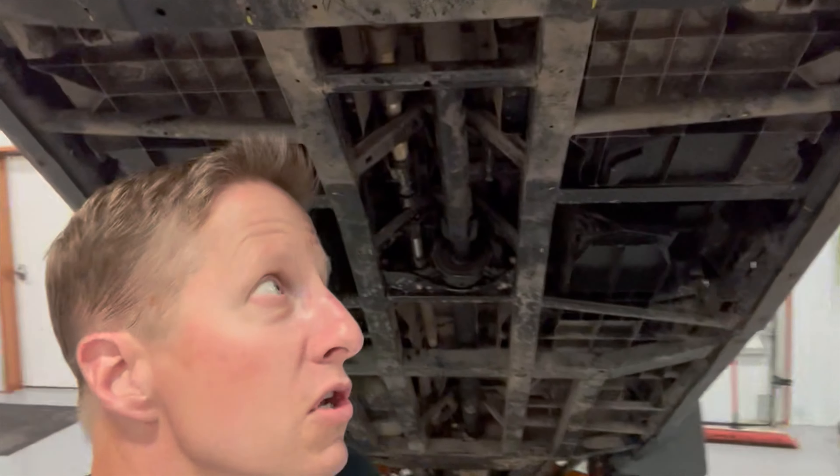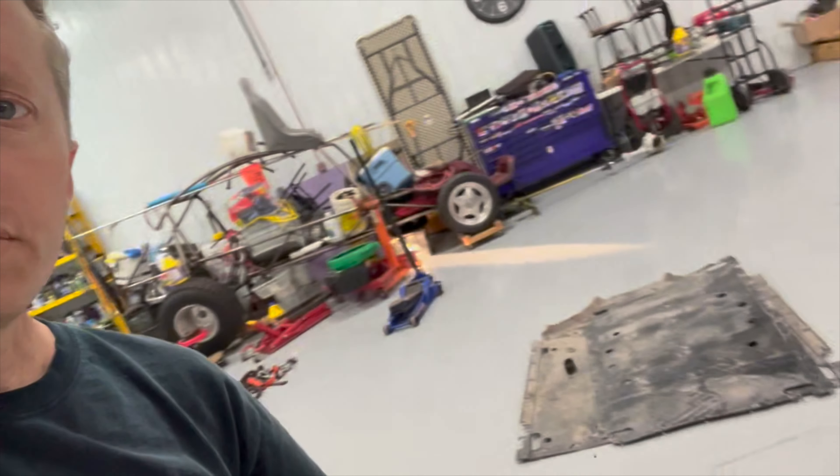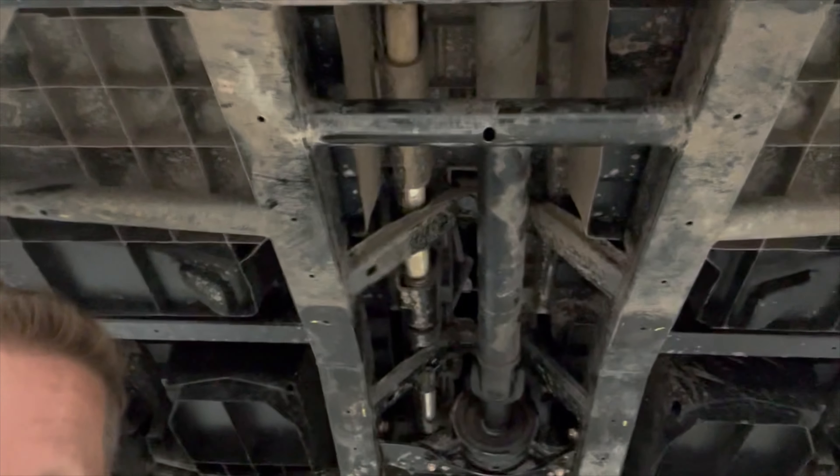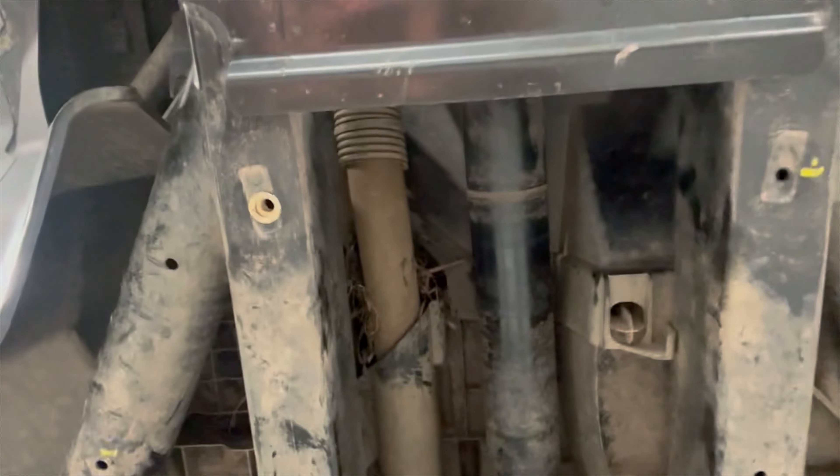I want to go through what you actually have to do to pull all of these off. There are a ton of rivets under here. Skid plates are off and over here. Use a 7/32" drill bit — kind of rotate the drill in the head inside there and they pop right off, came off super easy. All the skid plates are completely removed all the way to the back. We did a quick dry run of one of the nutserts right there — it works out great. Use a 10mm drill bit; a step drill is a lot easier and gives a nicer, cleaner hole.